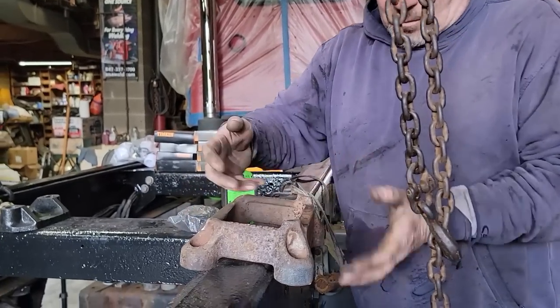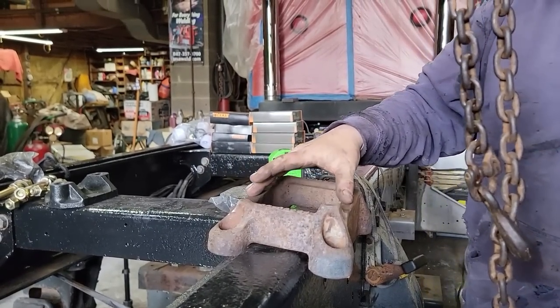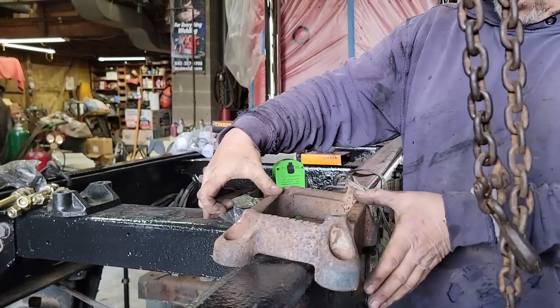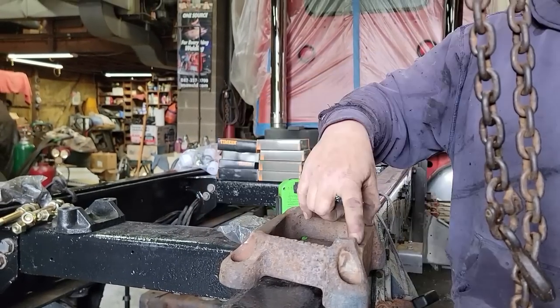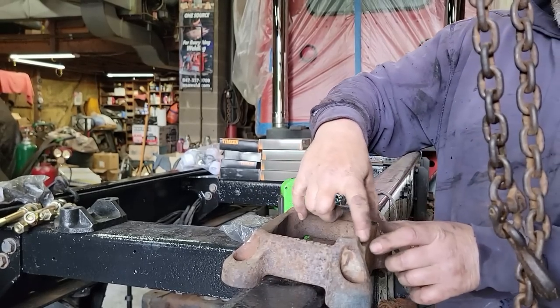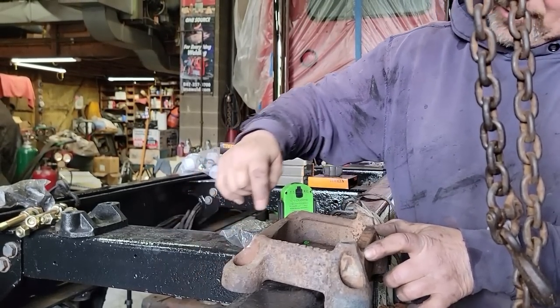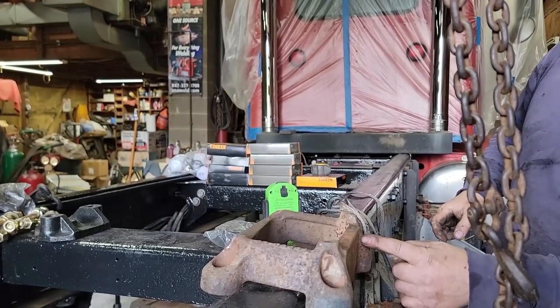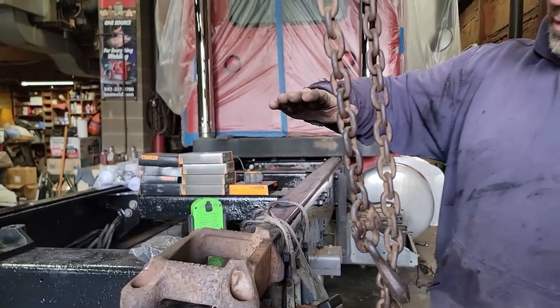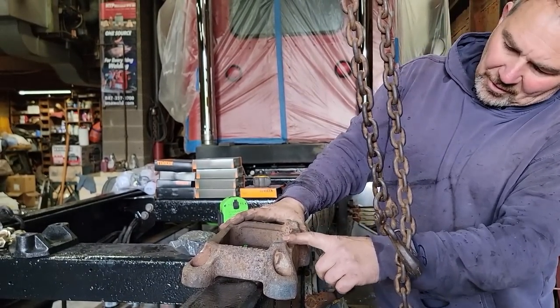This is the part that goes underneath the axle and gets everything sandwiched together. And there's several things to make mention of. One, this side is taller than this side. Reason being is, as the axle tube comes over this way, it kind of starts to roll and drop down. So this part is lower. And also, it's pitched front to back. So the pinion of the axle is going to be tipped up slightly. So that's where this is going to come from.